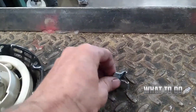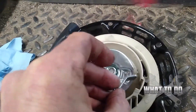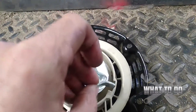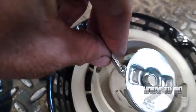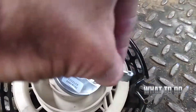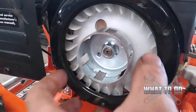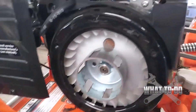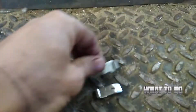The way these go back in — well, actually the way they operate is when you pull that pull start, these will retract out and they will grab right here. There will be one on each side, so one will come out of this side, one will come out of this side, and they will spin this, which in return spins your motor. So if you're pulling and the motor's not spinning, chances are you need a starter pawl kit, a starter ratchet kit.